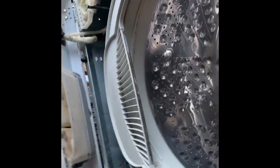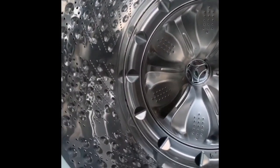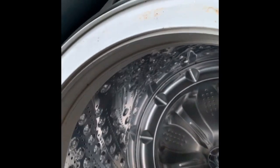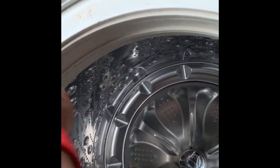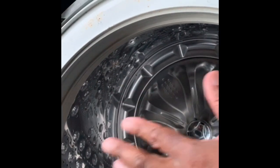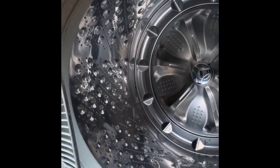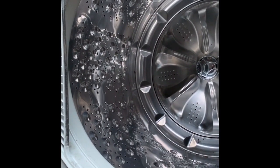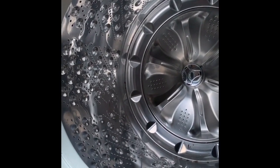The springs could be bad. You've got one here, one here, one here. You can test your springs by pushing down on them. If you push down with both hands and it just bounces up and down a lot, that means your springs are bad and it's time to change them. But if you press down and it gives a little bounce and then just kind of stays — not a whole bunch of moving around — you're pretty much good.